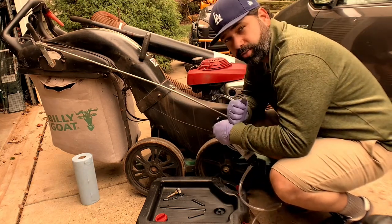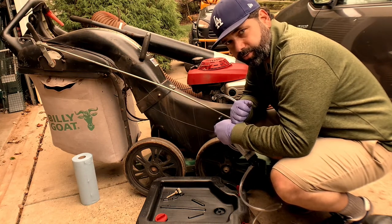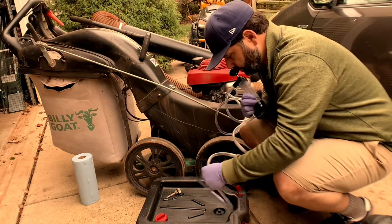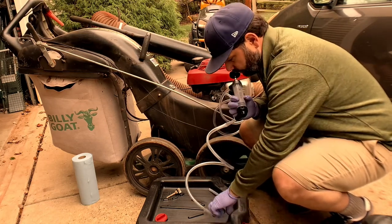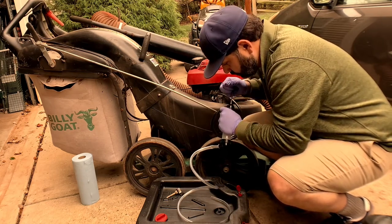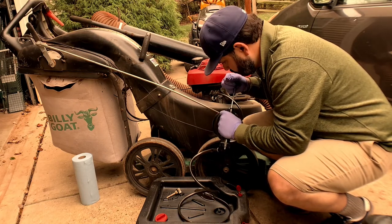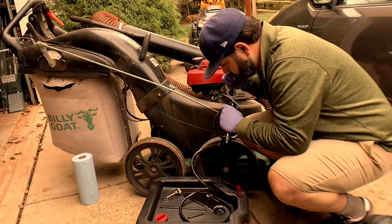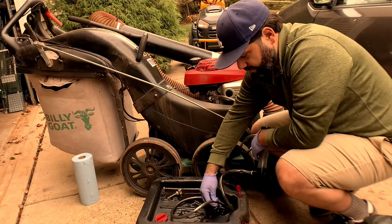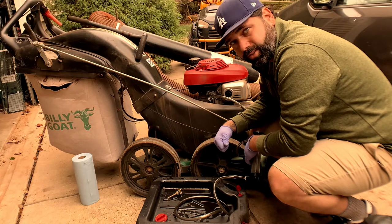Stick the sucking side into the engine and begin pumping. Now I did start this up and warmed the oil up for like five minutes, but I didn't want to bore you with that detail. We definitely want to let you know it's going to allow the flow of the oil to come out a lot more smoothly, and then just put your output side into your oil pan and start pumping. Hot tip: stick your tube down into one of these holes so you don't get a little bit of spray. I've got a couple of dots on the driveway there, but it'll just join the others.